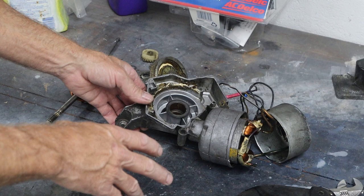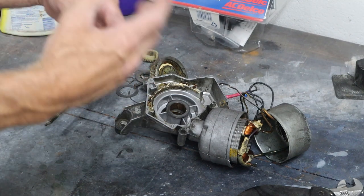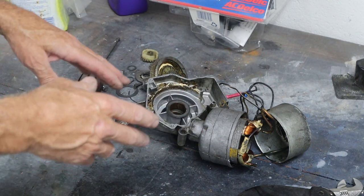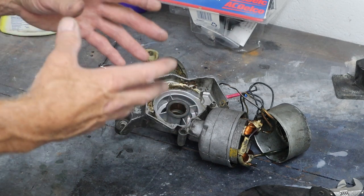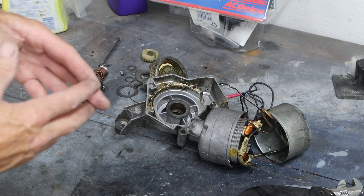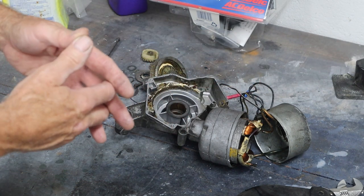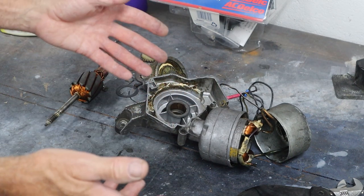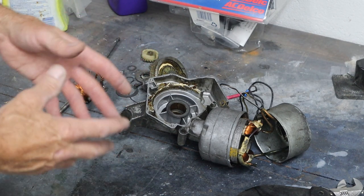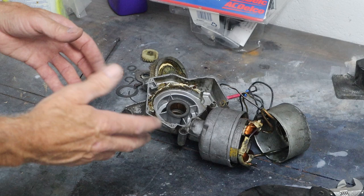Something wasn't right, so I bench tested it. I know quite a bit about early model GM cars, so I knew how to hook it up properly, but the thing would not park. I tried and tried — it just would not park. Obviously all this extra wiring and relays was the reason. I opened it up and that's where the park switch goes. There's an arm on the gear and a pole that comes around and engages it. When you turn the switch to off, it swings around, grabs the switch, clicks, opens it, and the motor quits turning. That's missing, along with wires and all kinds of stuff. It must've broken and they just did whatever they could to try to keep it operating. So we figured we'd just order another one — but guess what? There is no two-speed available brand new or even a rebuild where you send in a core.